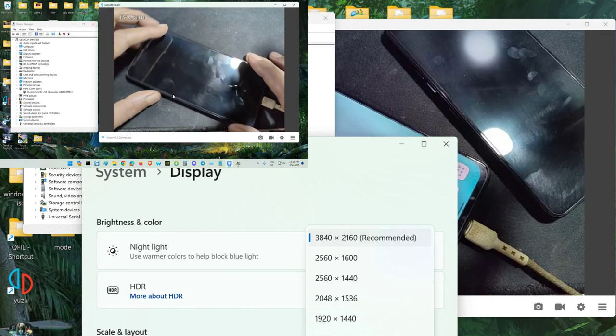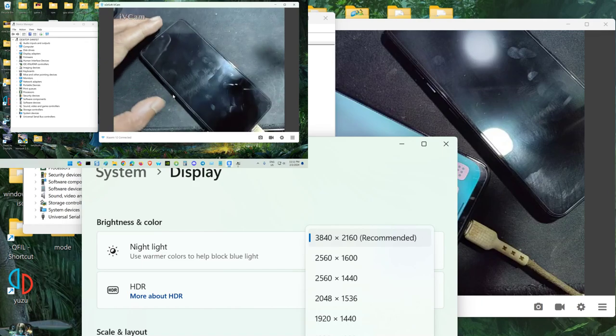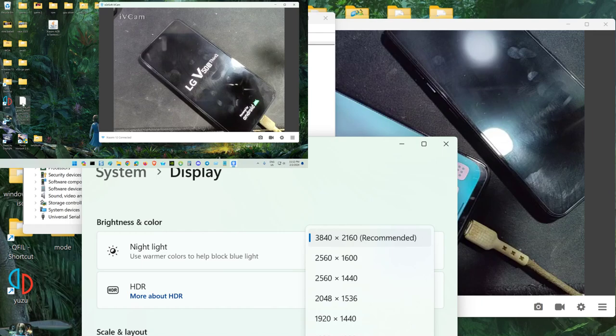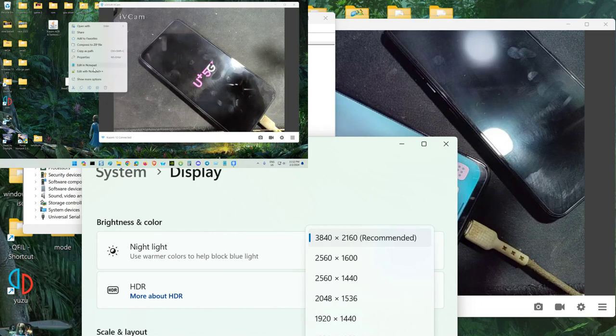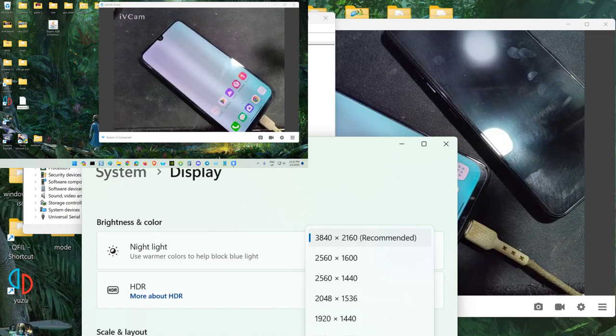And the phone is ready, you can switch on the phone. There is no other way to switch it on from the EDL mode, except you have to push these three buttons or two buttons, just enough. The power button and the volume button, or only the power button, doesn't matter. This is our boot image just now. You can rename it boot.bin. The bin can also be renamed to IMG, boot image.